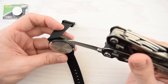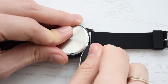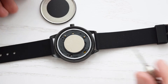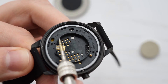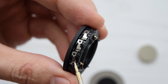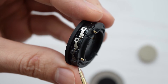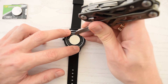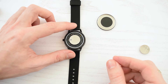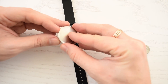You'll need a small knife or a thin flat screwdriver. As you can see, this area looks slightly different — there is a gap where you can place your knife. Once the blade is in place, use it like a lever to pop the back open. Let's see what we've got inside. There's a tiny button to hard reset the watch in case the side button doesn't help. This watch movement actually has three buttons — not sure if these two have any functions; I think the same movement is used in different watch models. It's a very simple process. Make sure that this notch is aligned above the watch button, and press down on the watch back until it snaps back into place.